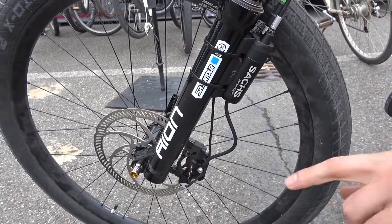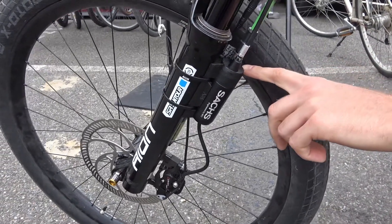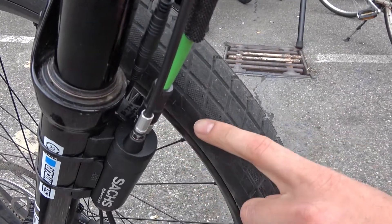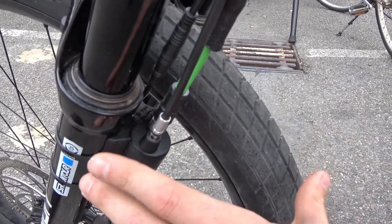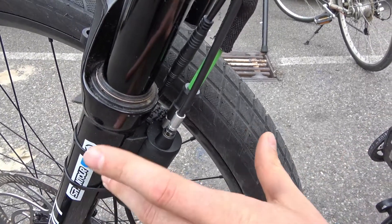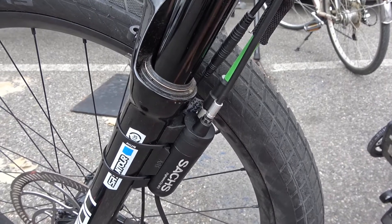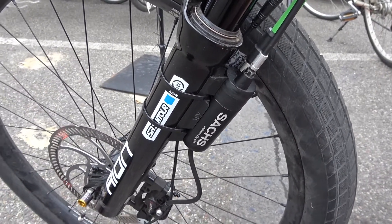The rollover protection works together with an integrated acceleration sensor, like you have in a smartphone. When the acceleration sensor detects that the rear wheel lifts, we also open the front brake to regain control of the bike.